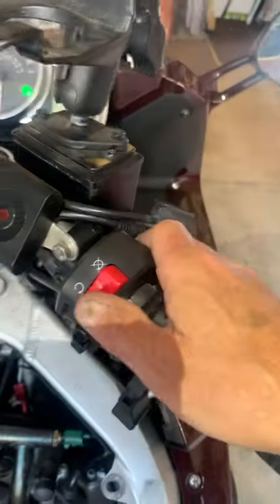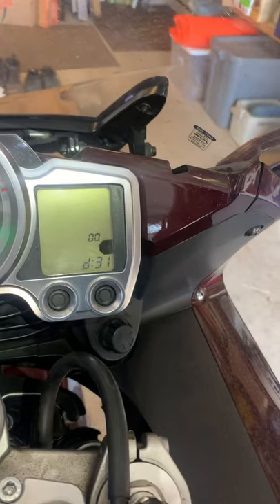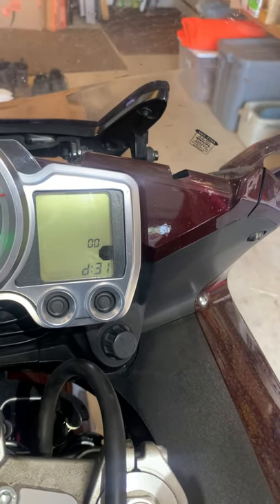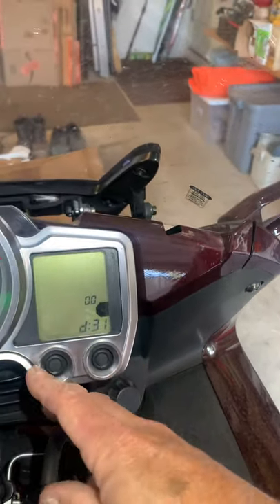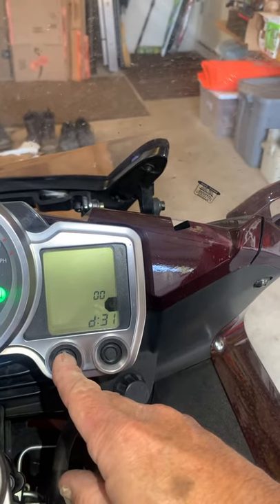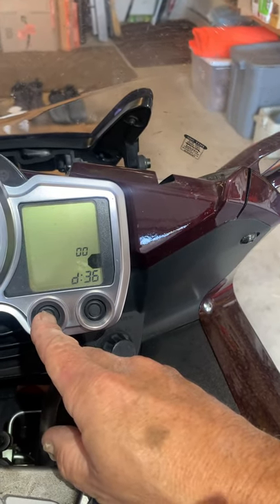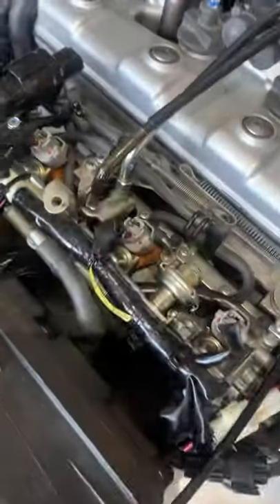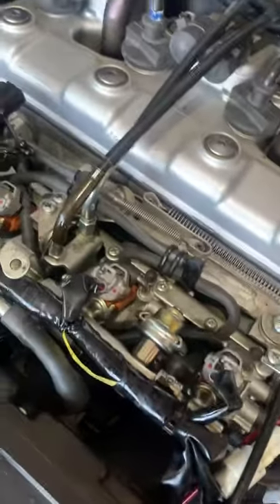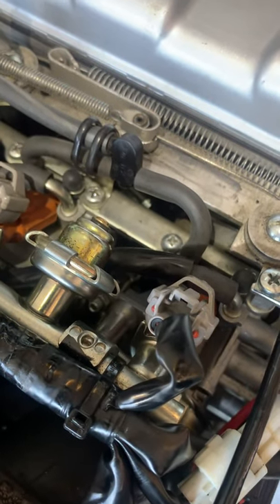Modes 30 and 31: if you turn the kill switch off and back on, it will stroke coil bank one and three, then coil bank two and four, five times each. I suppose with a voltmeter you could tell what's going on — I assume that's okay because the thing does run, just not very well. Modes 36, 37, 38, and 39: turn that on and off and it strokes injectors one, two, three, and four respectively, five times.